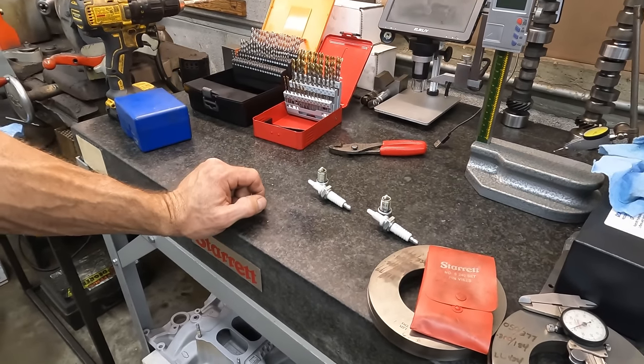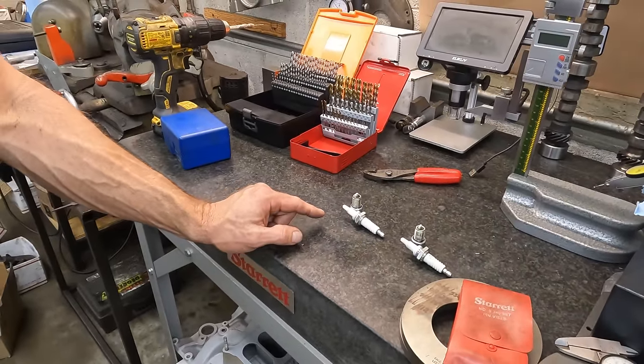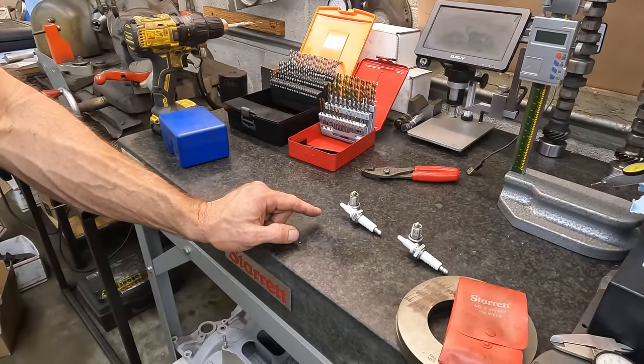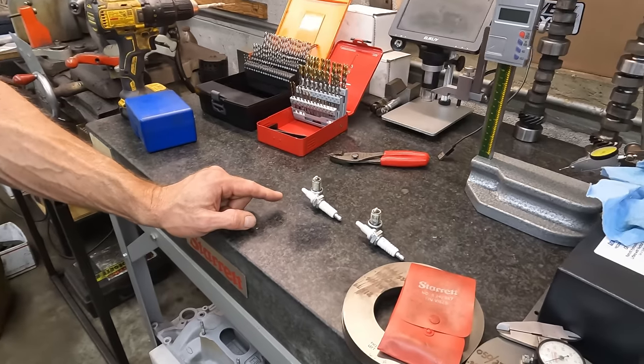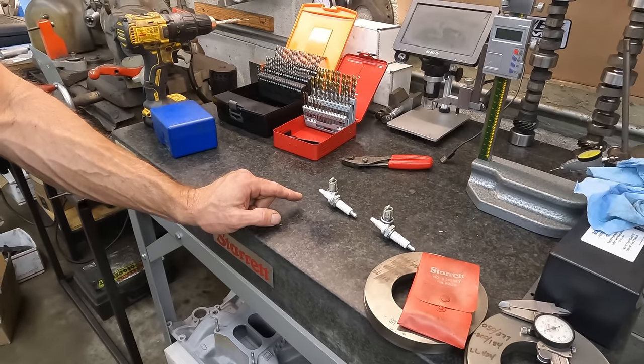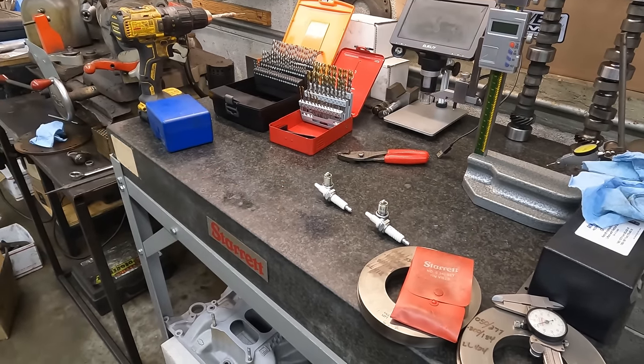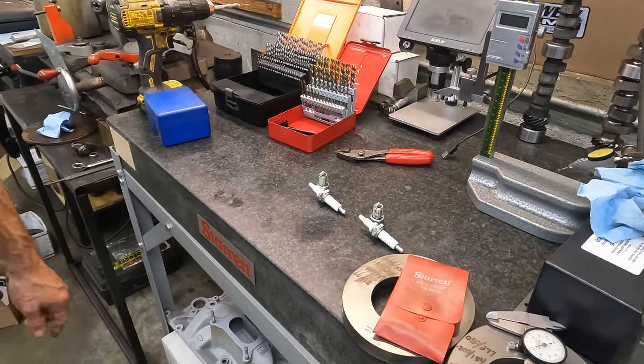We'll run to the parts store and we're gonna pop the carb off and probably go another 4 or 5/1000ths and just see what that does. And then we'll keep going till it doesn't get better, and we'll show the plug every time. So, all right, hang loose, we'll get another plug.